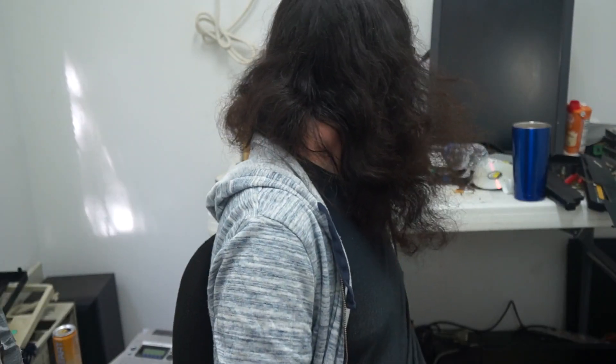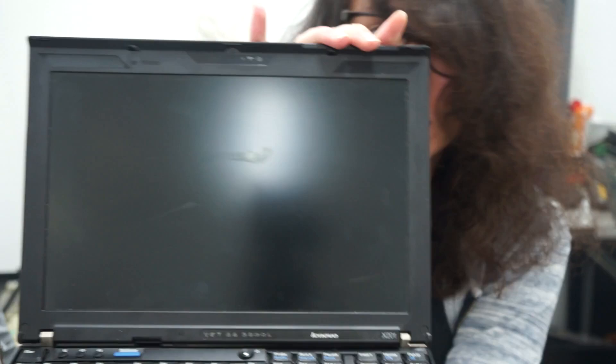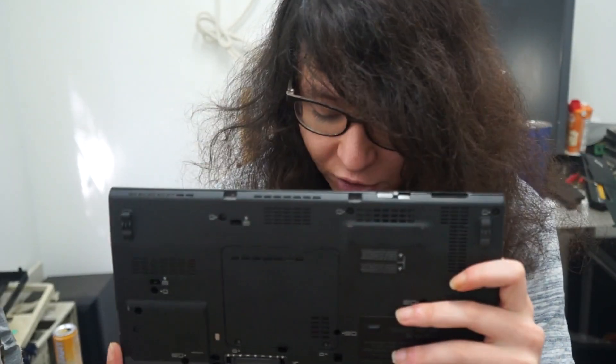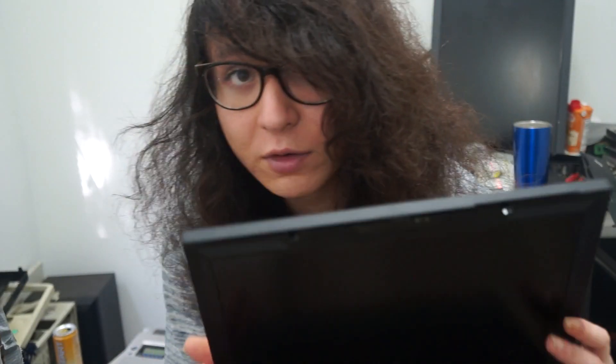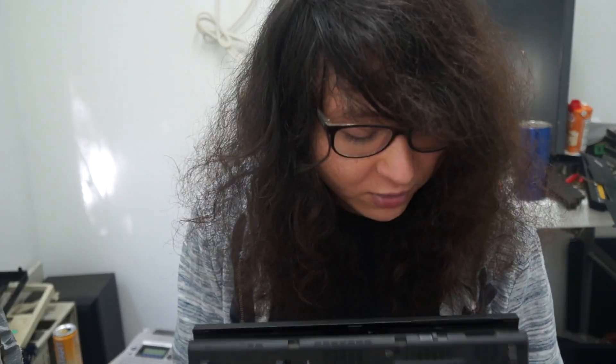Let's take a look at the recently built X200. This one is an X201 and pretty much all X201s are LED backlit. When I first started selling these, I was not able to get a hold of X200 bodies, so occasionally I would swap the X201 stickers with the X200 stickers. On the X200, the only advantage of having a CFL tube is you can replace it with a slightly nicer AF-FS panel, where you can't do that with the LED ones. But the LED ones aged a lot better.